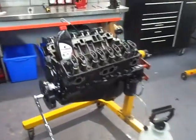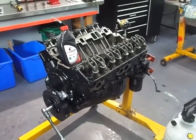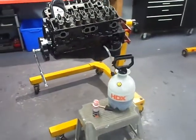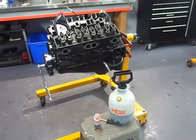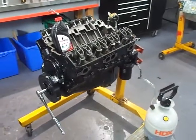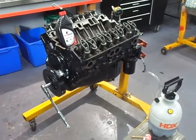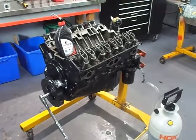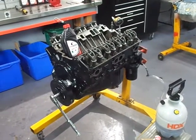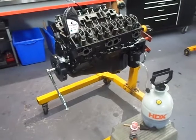This engine — I did not build it, it was built by a reputable engine building company — but the camshaft failed on startup, and that's not uncommon. Since then it's been rebuilt again by the same company and the owner brought it to me to see if I could get it successfully started up. The original flat tappet camshaft failure wore out a lifter and a lobe, dumped a bunch of shrapnel into the engine, contaminated the oil system, and basically required a total rebuild.